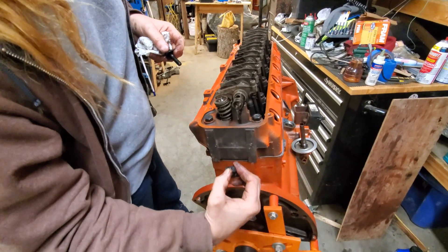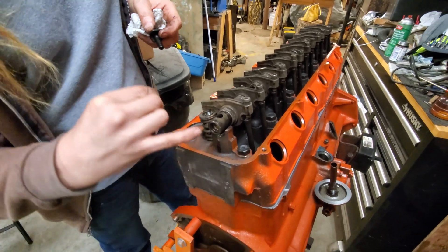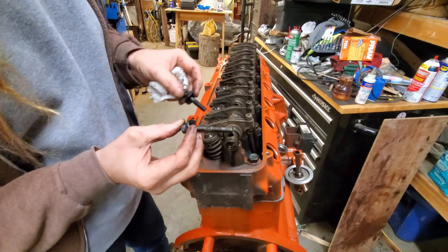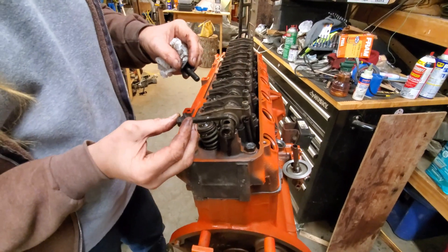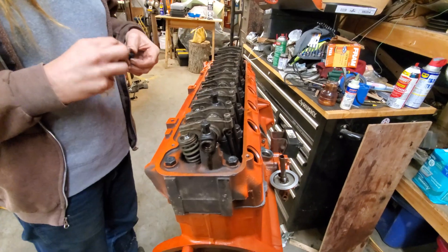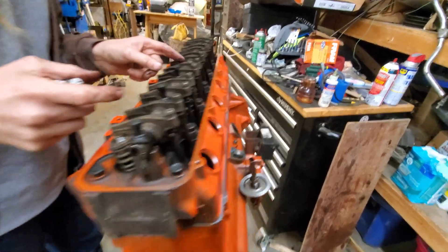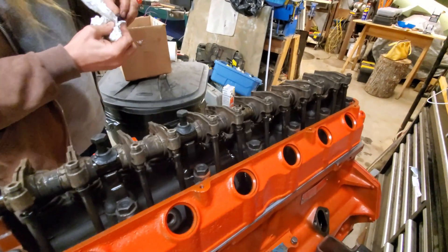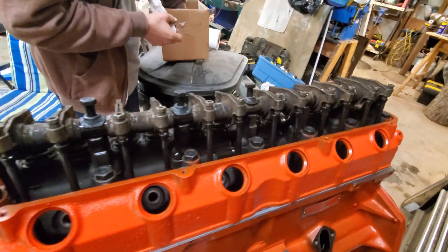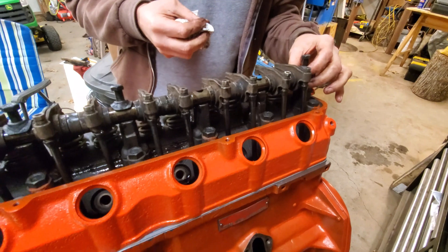This is the rear of the engine — the oil comes from the cam up through a port in the block, merges into this head bolt, and comes up through the stand into the rocker shaft. So this bolt is longer because there's a space in the threads, and somebody modified this bolt to make sure there was more free-flowing oil passage. The long one is always the rear one, and the rest should be the same — though we may be short the long one.